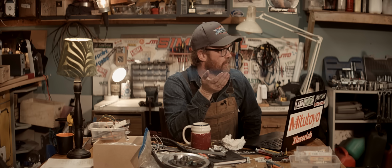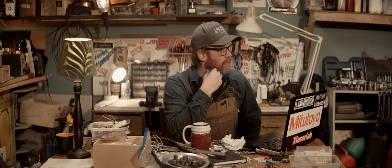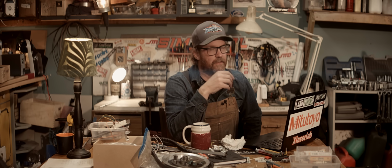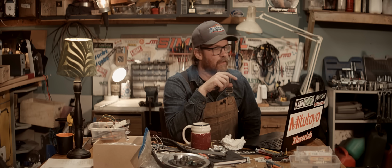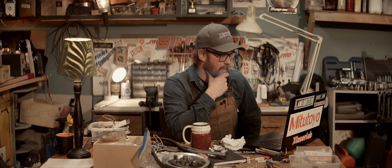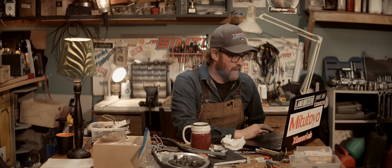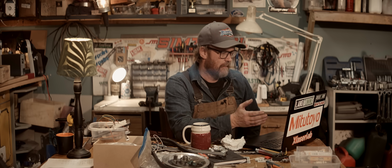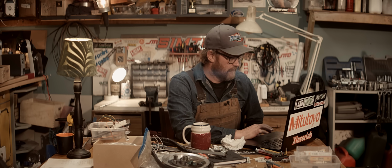I think what I want to do now is add a little more timing, 5 degrees more, and see how it behaves. Lots of timing shouldn't be too dangerous with this fuel because it's so detonation resistant. It's not like pre-ignition is the problem. If something starts glowing, then we have a problem. Could be we have a problem with too much timing too. We'll see what happens. Add 5 degrees more. Last time we added 5 degrees, we gained, I don't know, 3 horsepower or something like that.